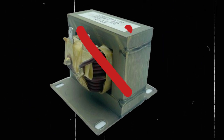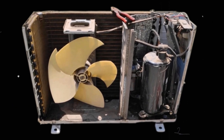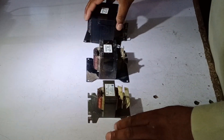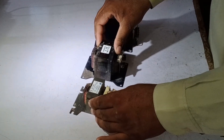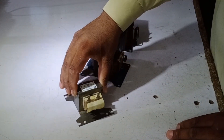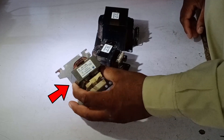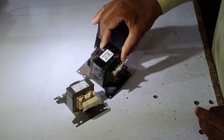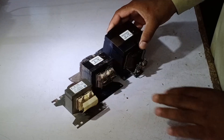If it is not installed with the system, these units will deteriorate very quickly and develop faults. These three reactors on the table in different sizes are used in different units — this first reactor is used in units with 4 to 5 amperes, the second reactor is for 8 amperes, and the third one is for 14 amperes.